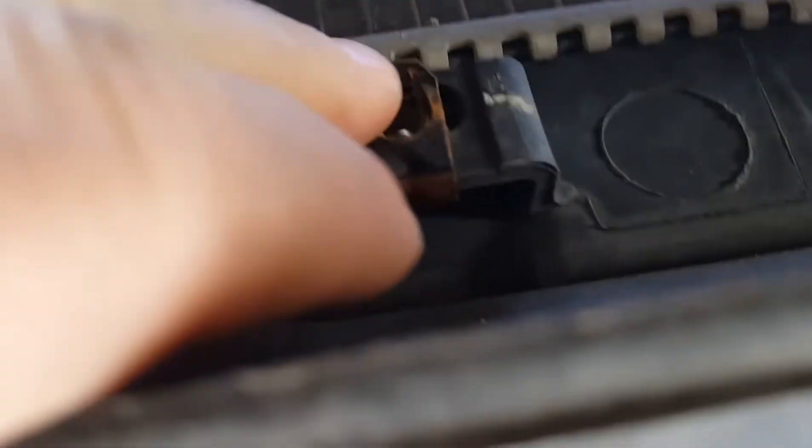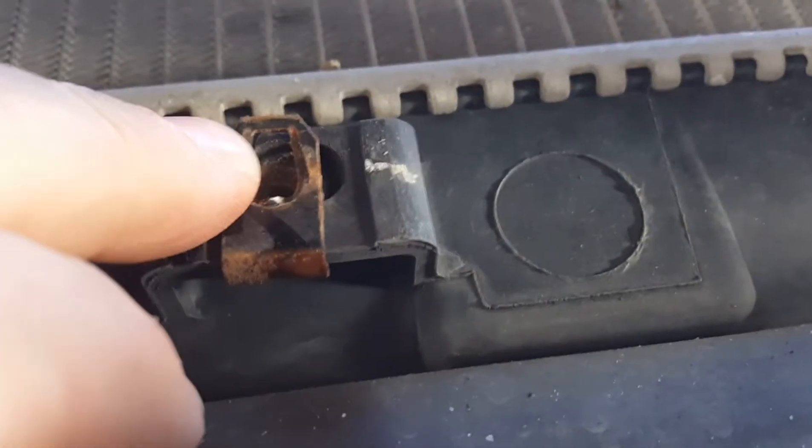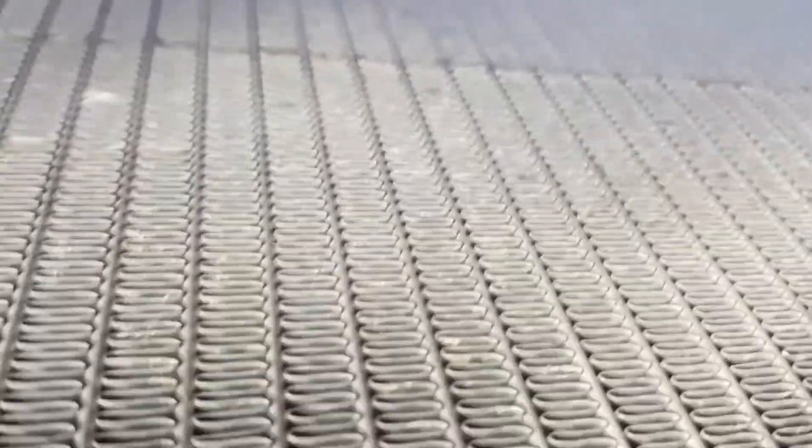First of all, here's where the screws are. There's two screws on the bottom — they are really close to the bumper, so you can actually get to them without jacking the car up. There's one screw hole here and one right here. Now what the videos don't show you is there are screws up in the corners — there's six screws total, and those are very difficult to get to. In fact, they're so difficult that the mechanic who last worked on this car didn't even put those screws back in. That's probably why this fan messed up again. This car has a hundred thousand miles on it and it looks like the electric cooling fan has already been replaced — this will be a second round.